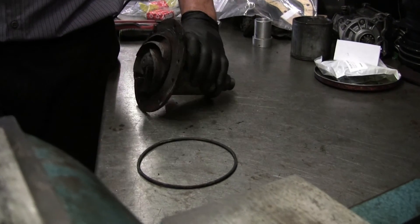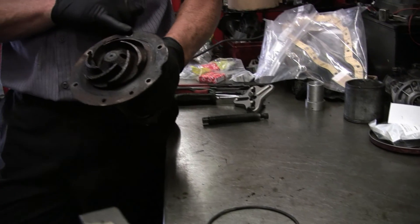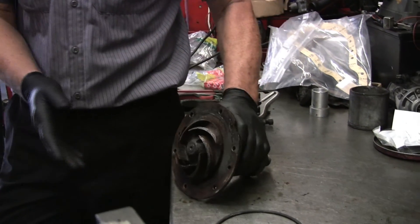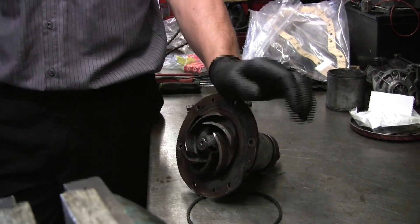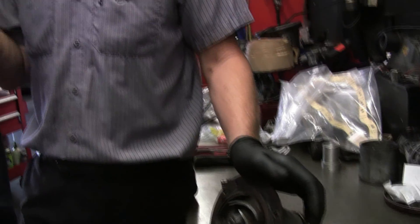This does not have a gasket — it has an O-ring that sits in a groove. There are five or six bolts that hold it on the car, and one bolt is a different size, so you put it back on the right way. It also has indexing pins. This is a 5/16 bolt; the rest are all quarter-inch bolts. They pretty much got away from all the British standard — in the Shadows there's still some, usually fuel fittings — but almost everything else is US fine thread, hardly any coarse threads.